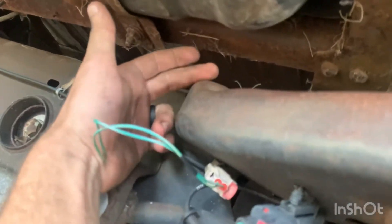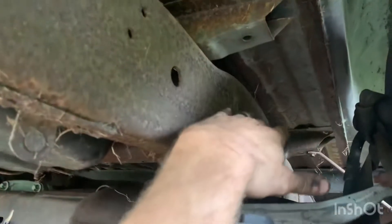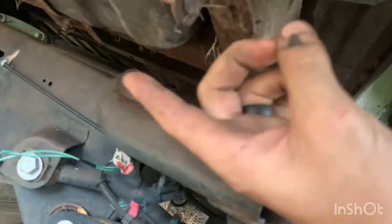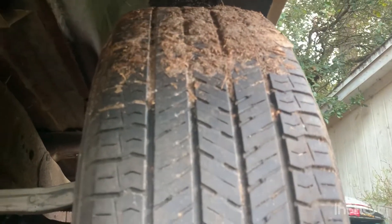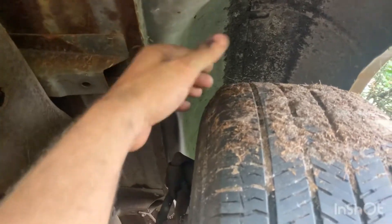If that clears the crossmember, I'm probably going to hack off this whole horn and figure out how to brace it — probably some gussets from the subframe up to the inside of the frame rail, and a gusset plate along the outside as well. Currently it's only sitting on the front sway bar mount and the sway bar itself, so I'll need to run a different style sway bar that comes behind or in front of it. I'll also need to notch a good bit right here for the control arm to have movement. I've got good real estate in the wheel well for wider tires — I'd like 20x10 on all four corners — so I may need to cut a small portion of the inner wheel well for proper suspension travel.